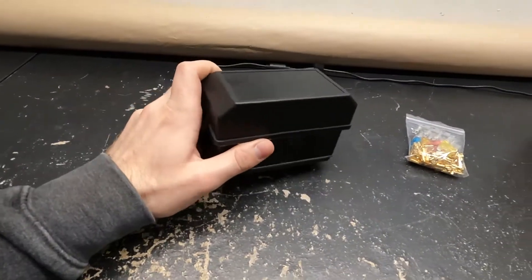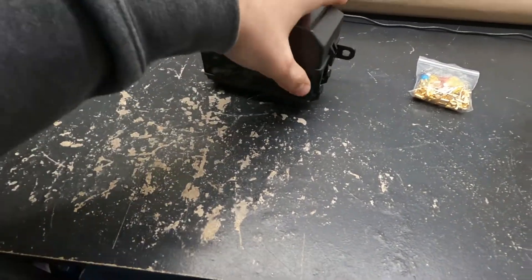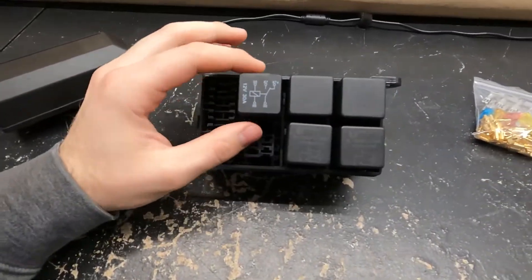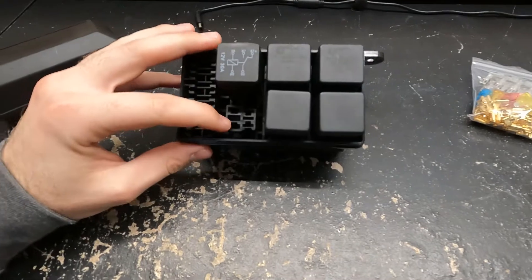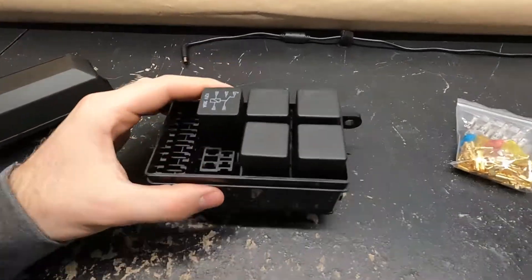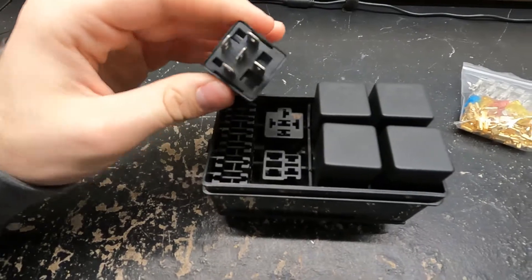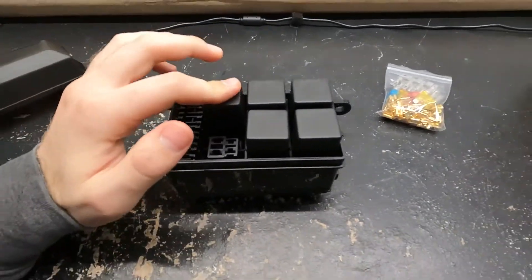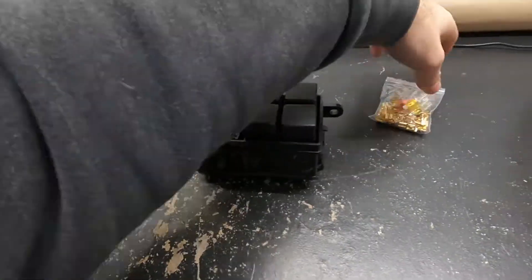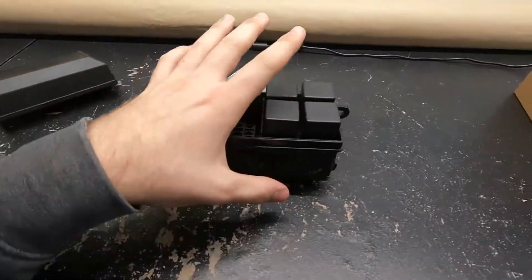So this is the relay box that I got. It's just one I bought off Amazon for like 20 bucks — I'll put a link down in the description. Basically you have room for five relays, and you can get a sixth relay but it's a different design and I don't need it. So I got a five relay box. It comes with five of the four prong relays, but I needed a five prong relay for one of my wiring things. So I got an extra five prong and cut the little mounting tab off so it fits in there. It also comes with all these terminals and fuses so that you can wire it up on the bottom.